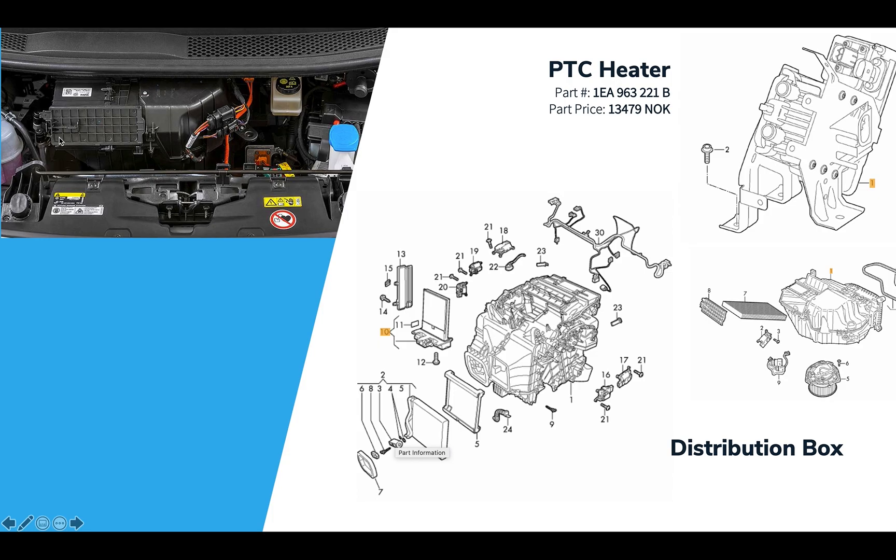Looking through the top of a picture of the ID3, this is what you'll see when you open the bonnet. This component here is your distribution box. If you open it as per diagram eight, you can take out filter seven and get to some of the other filters — this is probably one of the few user-serviceable parts of the ID3. You can open it up, take out the air filter, blow it with compressed air, and put it back in. Underneath the intake box sits the unit that controls how much hot or cold air goes left, right, or to the back — the distribution box.